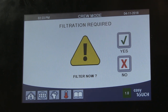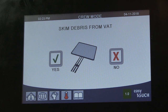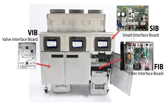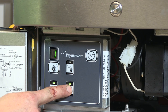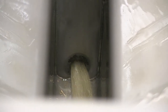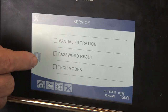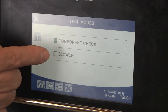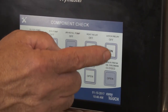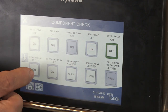Features such as automatic filtering and automatic top-off operate much like the LOV fryers. The circuit boards that oversee the functions have new names, and in one case, some of the duties have been combined. The earlier fryers have an MIB, or Manual Interface Board, which allowed manual operation of aspects of the fryer's filter system. The touchscreen controller — an M4000 on McDonald's fryers and an FQ4000 on FilterQuick models — takes on the diagnostic and operational functions of the MIB in conjunction with other boards on the new platform.